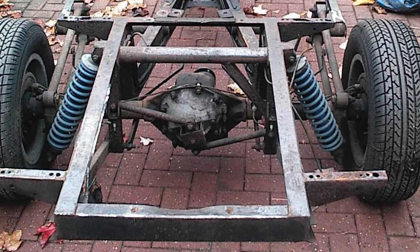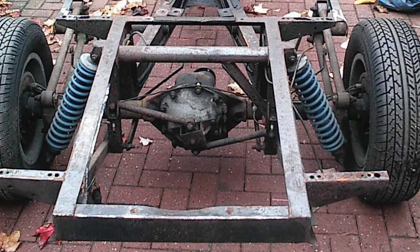Coming to the centre, we've got what's known as a Watts linkage, and this is the linkage that keeps the axle straight on the car. As you can see, it's all attached through poly bushing to very strong components on the chassis. That keeps it in line, and then coming down I can see the dampener sitting at the back going back up to another part of the chassis.